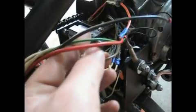Then you've got your brown wire, which is the opposite brush. It comes from the regulator rectifier, and this one's the tricky one — it splits. At this point it is both fed electricity from your key switch, and it is also feeding electricity to the regulator rectifier as well as the rotor stator assembly brush. That's another brush line.